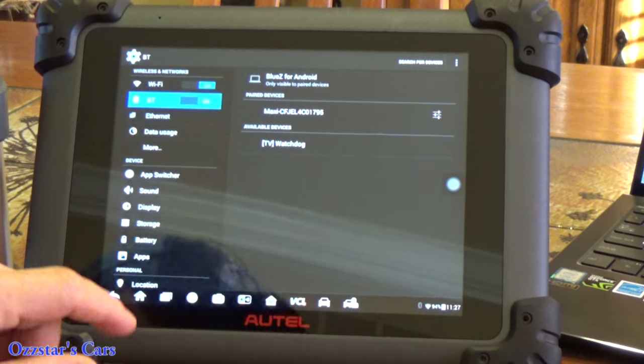Here's an adapter I've actually used — on an E36 BMW, under the driver's steering wheel you have a normal OBD port where you can plug in your VCI and get some data. But if you go under the hood near the passenger side, there's a round connector, and a different adapter plugs in there for a lot more data. I've used that one under the hood. You also get adapters for Audi, Benz, and Mitsubishi. Pretty self-explanatory.